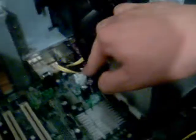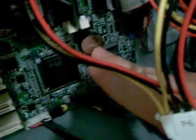And also, because it's a Pentium 4 PC, we have our Pentium 4 power jack, along with our 20-pin power jack there, and BIOS and the floppy controller there. And this is for our front USB, that cable there, if you can see, along with that one, which is for our front audio. And that's our front connector as well there, for connecting it to the front control panel, which, if I turn the computer back over again so we can all see a little bit better, you'll see that we have our hard drive there as well, along with our connectors for our front lights and buttons, the power supply up there, and a green light there which tells us it's on. CMOS battery there, for keeping the BIOS settings, buzzer, everything like that.